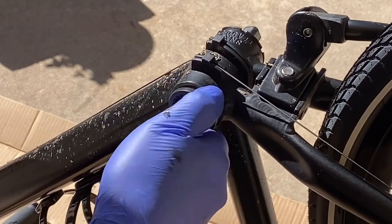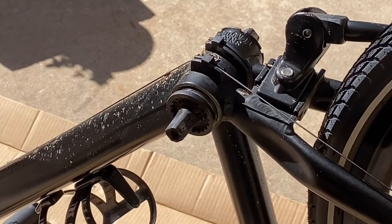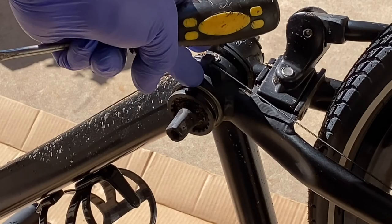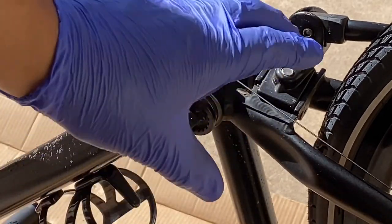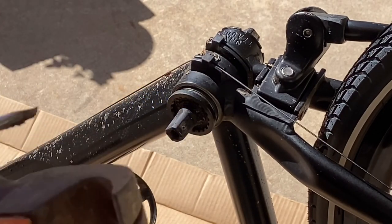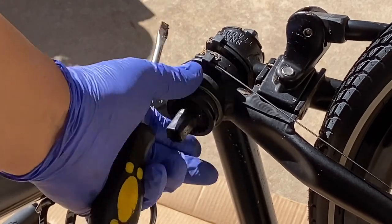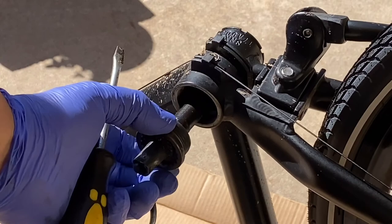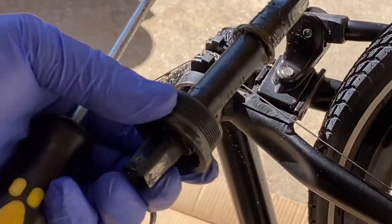You see how easy it was with just a few taps? Keep in mind I keep mine well lubricated, so the threads never seized inside the housing. Again, this method is only for that purpose — if it's rusted out, don't even bother, you're going to need the proper tools. Anyway, as you can see it's already loose. I'm going to go ahead and get the other side off and then we can install the new VP cassette bottom bracket.